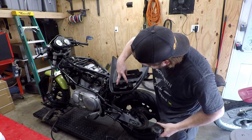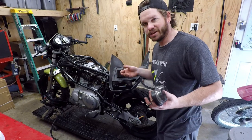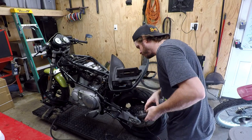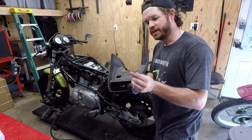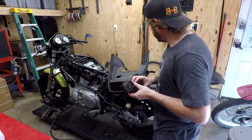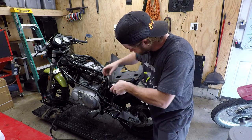All right, I got my holes drilled in both pieces, and being that this piece is a lot thicker and I'd be doubling it up, I'm gonna go ahead and avoid making another bracket for the rear. I'll just put a washer on the back and we should be safe on that. But anyway, yeah, that's gonna fit over like that. That right there. Went ahead, tested the light, confirmed which ways, left, right, brake, that kind of thing. And all I gotta do is match up the wire code on the Buell harness and we'll be good to go. So let's get this on here.